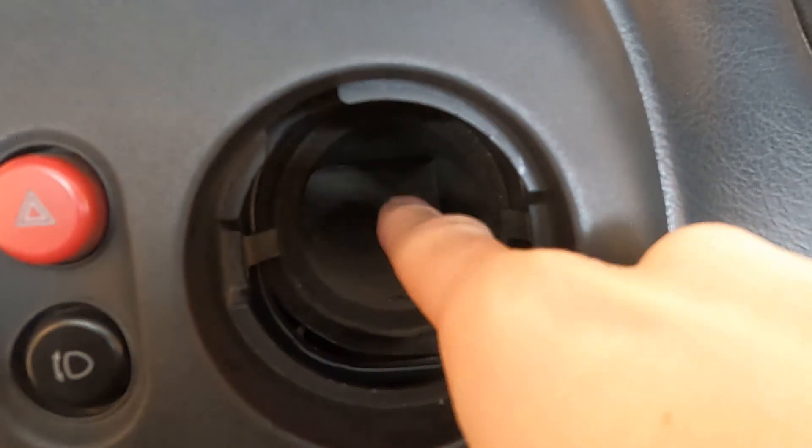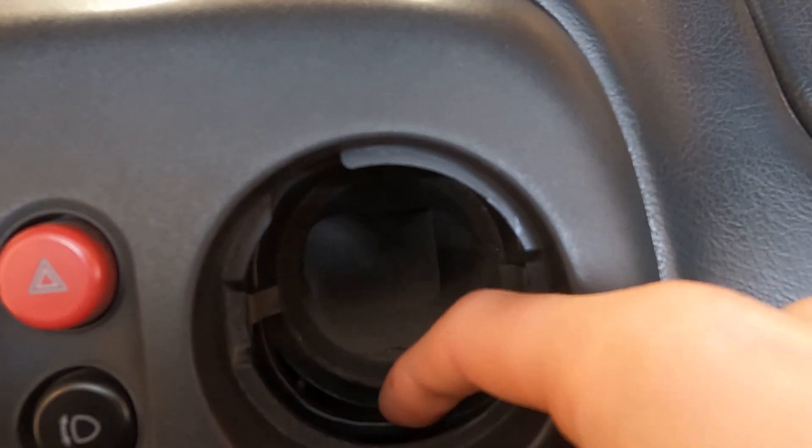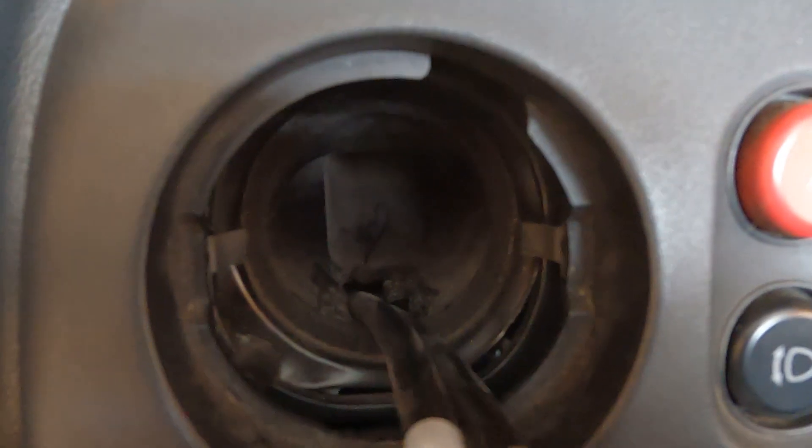Before getting too far into wiring or installing the vacuum line through the dash, I need to modify the vent tube that comes up from the blower motor. I need to either put a hole in that tube or fully remove it from behind the dash. That tube brings heat into the interior — there's a slight gap but the gauge is too deep for it. Looking behind the AFR gauge, I did the same thing: just popped a hole in the bottom of that tube.